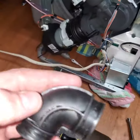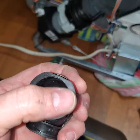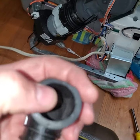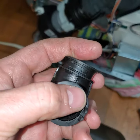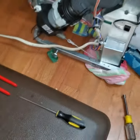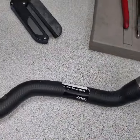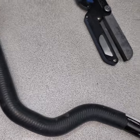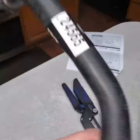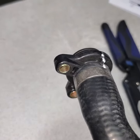So what I did is I said, what do I know that's 90 degrees like this that would be almost the same size on both ends? This is about an inch and 60 thousandths, and this is about 950 thousandths. So I thought about going to the auto parts store and just looking at any heater hose assembly on the rack. This one happens to be a Gates 24565, and it has this funky fitting on the end.